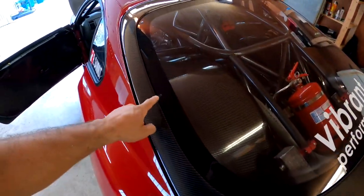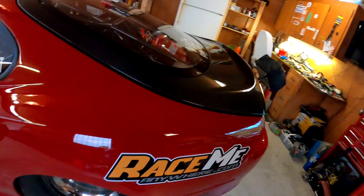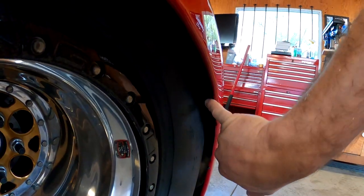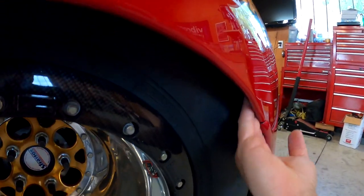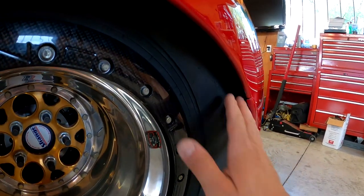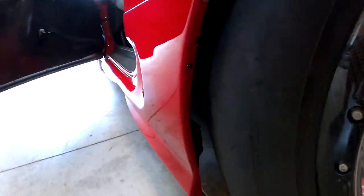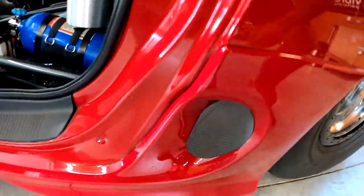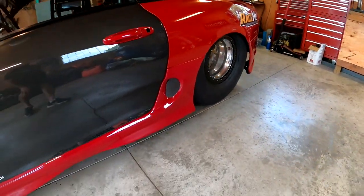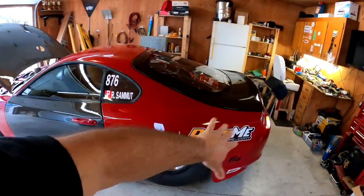I put some screws here just to make sure the window doesn't come shooting out. I did add some more clearance to the tire here because it was a little too close, so I had to shave here as thin as possible. Now there's about a finger and a half of clearance. The radial doesn't really grow, but I was worried that when it wrinkles it might touch. There's lots of room on the other sides. I also added a panel to close up that hole — I didn't want air going underneath there. It's a clean way of keeping it nice and sleek.